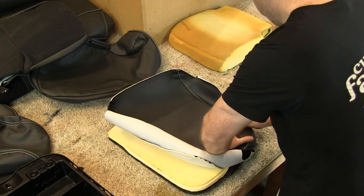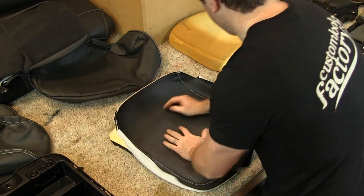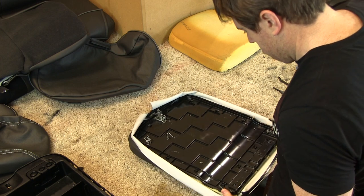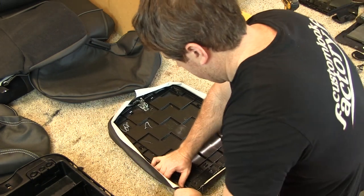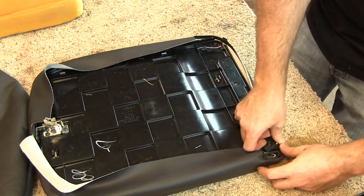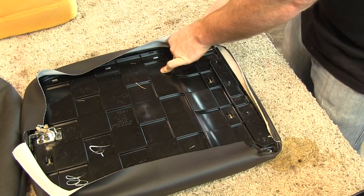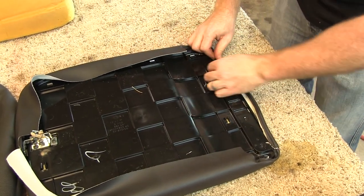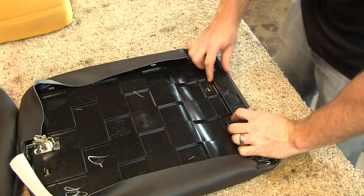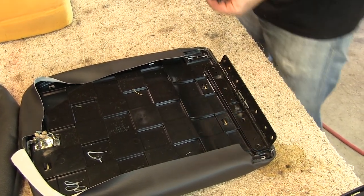We start by positioning the perimeter seam, and then move to stuffing the plastic clip at the back of the console lid into the channel built into the console lid plastic frame. With the plastic clip installed, we reinstall the console lid hinge, which holds the clip permanently in place.